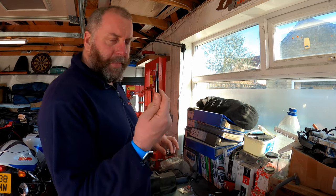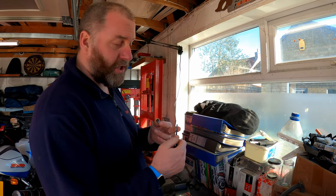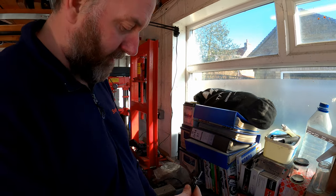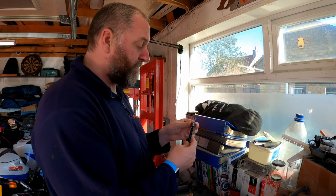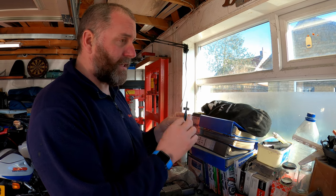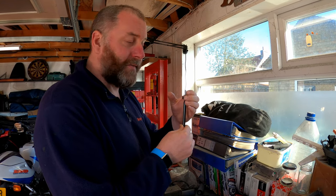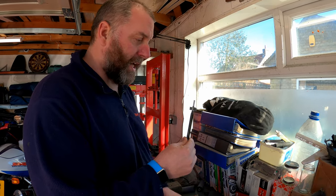What I'm going to do, I've got a pin punch here, and I'm going to use this to demonstrate it. Imagine that this is the stem of a valve. I'll pop it over. So, obviously, picture the fact that the lifter is on there. But in normal operation, below 6,800 RPM, the valve stays shut against spring pressure, because there is a conventional spring with a spring cap holding the valve in the closed position, and there is an additional spring outside of all this which the VTEC bucket acts upon to reset itself. It's completely independent.